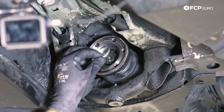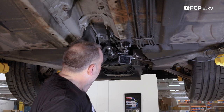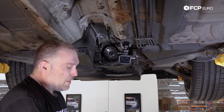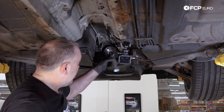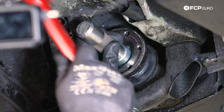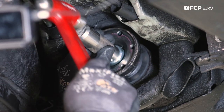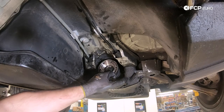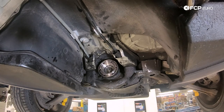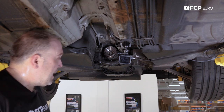Here's our new retaining ring. It basically sits over the hex in the nut. Then there is this special adapter from BMW — a universal seal driver — that is going to deform and press the edges into these two notches. It's been pushed all the way back and those two tabs have been pushed outward into the two ears. You could do that with a chisel, but this was relatively cheap and it makes it super easy — there's no doubt about it.